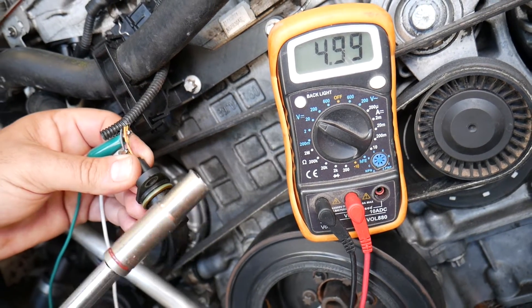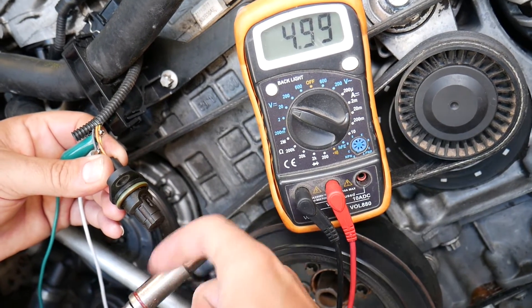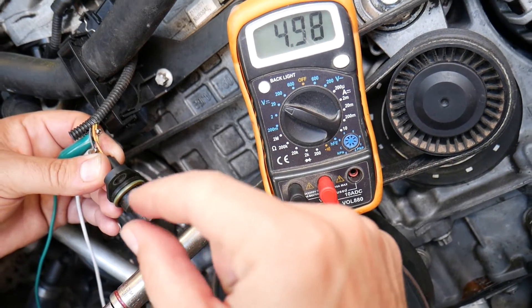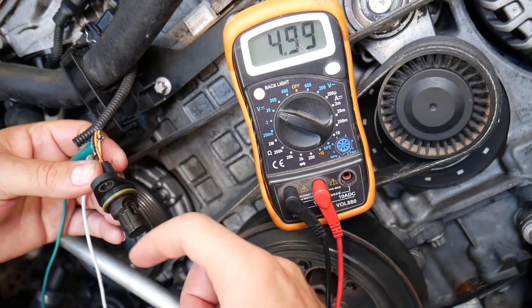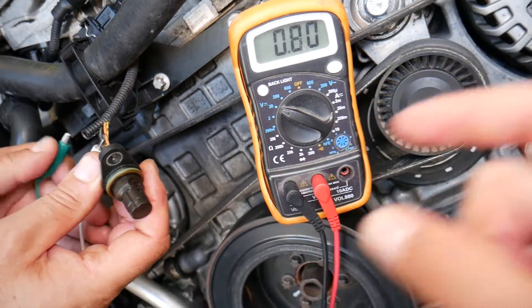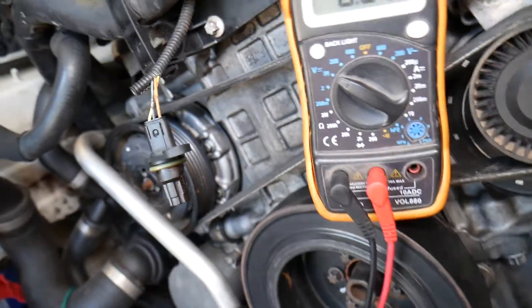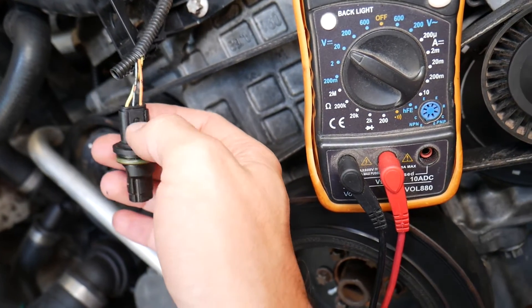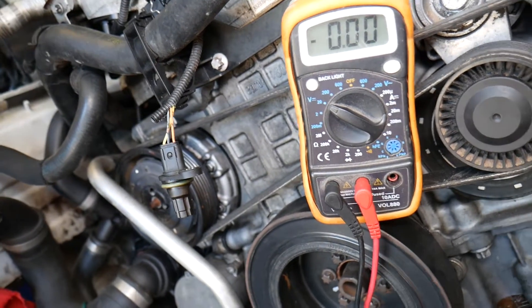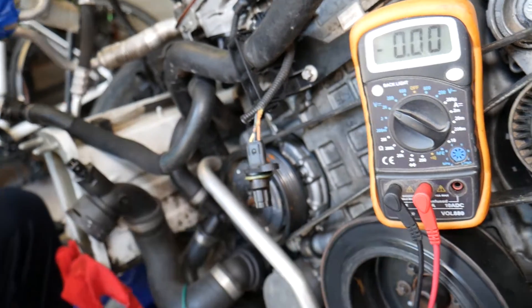There is a powerful magnet that will pull the sensor toward the camshaft when the car is running. The camshaft spins around the camshaft position sensor, and there are different bumps and slots on the camshaft that pass through it — the sensor reads this as on and off signals. So as long as you attach a metal tube and it reads zero, your camshaft position sensor is good. Note that extra oil from a valve cover leak getting into the wires can cause a false bad-sensor reading, so make sure to clean that up. Hopefully the video was helpful — thank you for watching and see you guys next time.